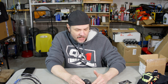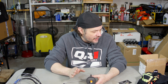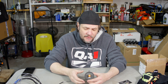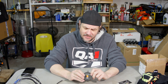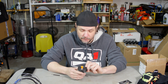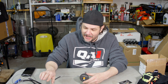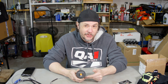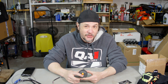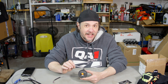It'll look good mounted in a gauge bezel or a gauge mount on your A-pillar. Great idea, Nick — thank you for sharing it with us. Make sure you go out and check out Fowler Tuning. If you're tuning on a boosted application, I highly suggest you get this. I bought a more expensive one — probably at least twice as much — for doing the Typhoon. This is one of the things, between this and a wideband, that is going to save your motor. If you can listen to it as you're doing your data logs and you start getting into knock, you can get off the throttle as soon as you hear that first ping and save your motor.